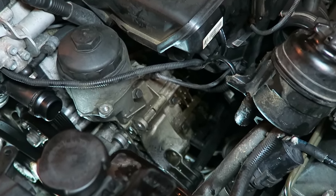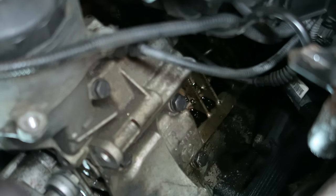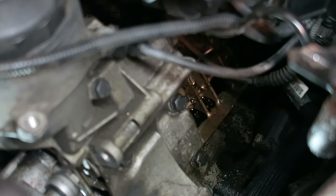Check out all of the oil that is leaking from this thing. As you can see, the fins on the side of the engine block are full of oil. When you do an inspection on the car and you see oil in the fins right behind the housing like that, that's a classic indication that the oil filter housing gasket is blown out.